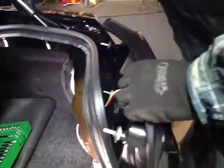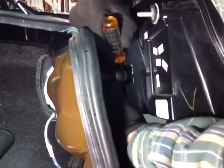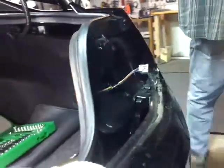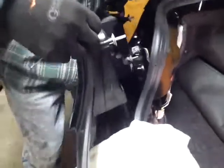Now you've got to remove this wire connector. For the tail light, you've got to pop this tab up and pull out — pop it up like that and pull out. The tail light comes out. Pull it, pull the tab out, pop out the connector, and that's your tail light.